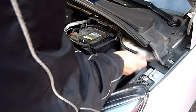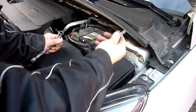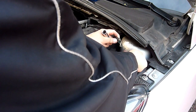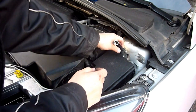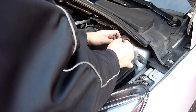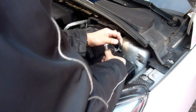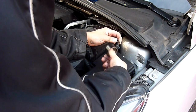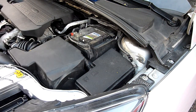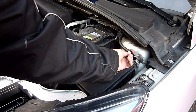A really bad battery that's leaking lots of hydrogen might cause a pop. Now I need to tape that terminal - don't let it touch anything. Use electrical tape only - black for the black terminal. Cover all of it; I noticed a metal exposed bit there, so cover that as well so all metal is covered.